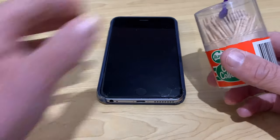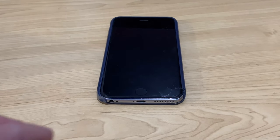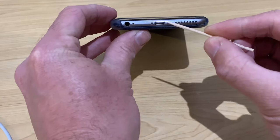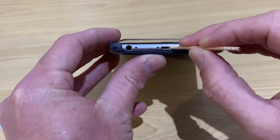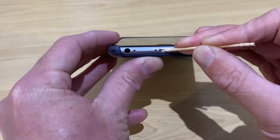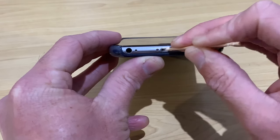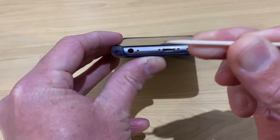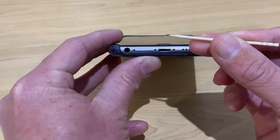So we'll unplug the cable there. We will grab just one toothpick — we should only need one or two to get this done. The reason that the connection doesn't work a lot is that sometimes little bits of crud and pieces of lint, especially if you keep this in your pocket, are going to get caught up in here. So if we just start digging around in here, what we're going to find is little bits of dirt, little bits of dust and other foreign particles blocking up this port. So I'm going to continue doing this — look at that. You get a big chunk like that.